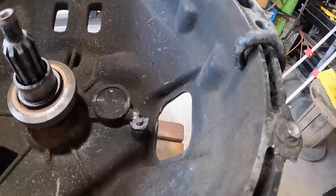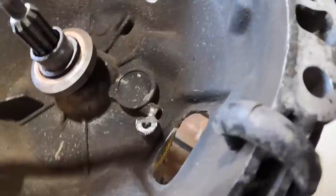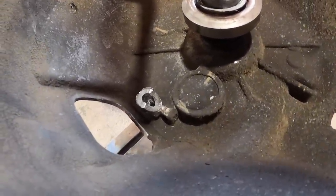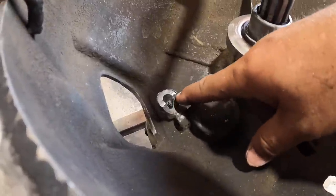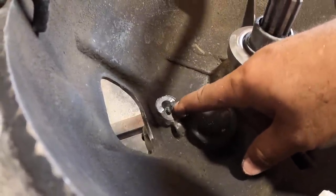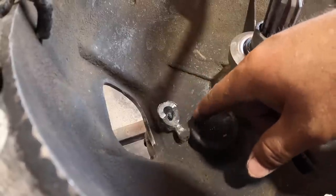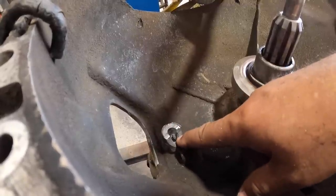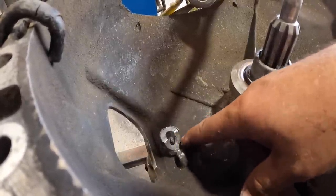It's going to be tight. So I don't know how well I'm going to film it, but if you've seen other YouTubers that have done these repairs, they're not that tough. I will have to clean it as best I can, hopefully get some shiny metal in there so that I can boil out all the impurities in that cast before I start adding filler. I'm not quite sure how I'm going to go about making that dowel again, because I don't necessarily want to fill it all in. I just want to fill in this area here.